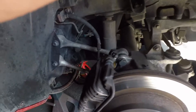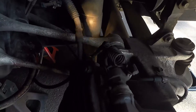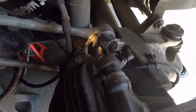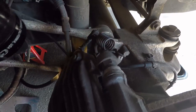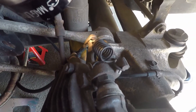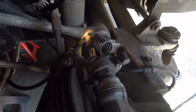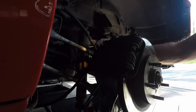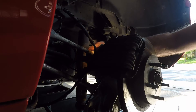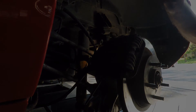What I have to do is unhook the brake cable from the lever. The lever has the spring on it. All I need to do is disengage that right there, and now this is loose — so it's not under load, it's safe. If I pop this up and off the lever, it's free. It's your car, but it's fine.